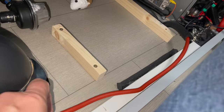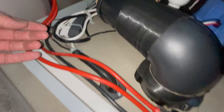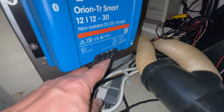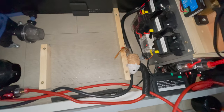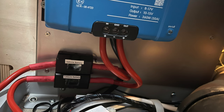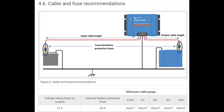Now we're going to connect the power along here and onto where we're installing the B2B. We've got the positive input which runs through this breaker and then goes to the vehicle battery. The ground - the black wire - feeds back to the bus bar, and finally the positive output comes along and feeds into the control box. To finish it off I added two 40-amp fuses, one on the input and one on the output, just to make sure it's safe. Prior to installing I double-checked the manufacturer's literature, which states that for five metres of cable run it's 16-millimetre-squared.